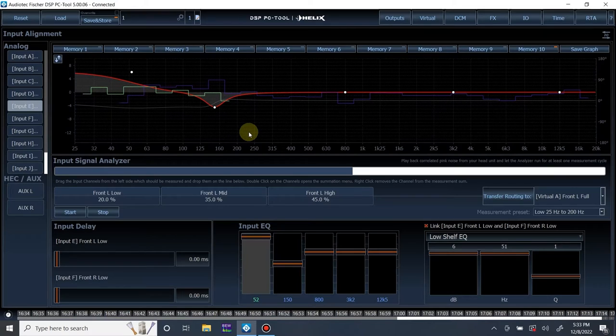It's going to be the same phase. It's much easier to work with. Even if it doesn't sound bad on its own, when you play them together, you cannot get your subwoofer in phase with your front stage. It could be because they have some crazy signal delay applied to the front stage or the subwoofer in the factory signals, or they have some weird all pass filter or FIR filters or something of that sort going on. You can just use the corrected front or rear signal to make things predictable.